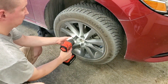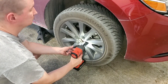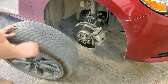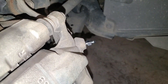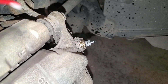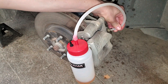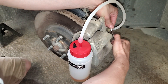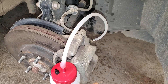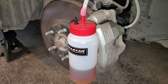On a side note, I normally use an air impact wrench, but I picked up this cordless mid-torque impact and I'm loving it. The dust cap is larger on the front bleeders, and the calipers are larger too, so there's plenty of room for the bottle. Without a bottle like this one, you'd have to have someone else push down the brake pedal while you open the bleeder, then tighten the bleeder before they let the pedal back up — and you'd need to repeat this many times for each caliper.